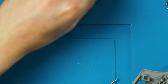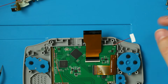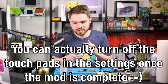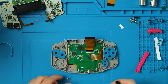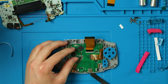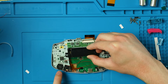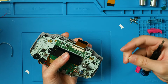I'll turn off the soldering iron for a bit as we save the last bit of soldering for the end. If you want to keep the touch pads, you're welcome to — one's for brightness, one's for color palette swapping. I'm going to install one here underneath where the screen connector will be, and stick the other one down in the open area below, with the wire out of the way. From here, everything is technically locked down, so we can take our motherboard and place it down over the top. Make sure your speaker goes in its hole correctly.